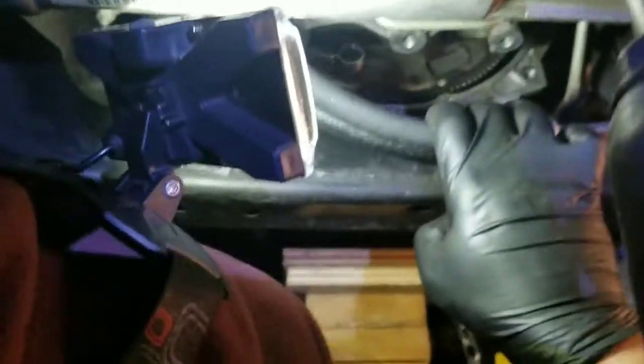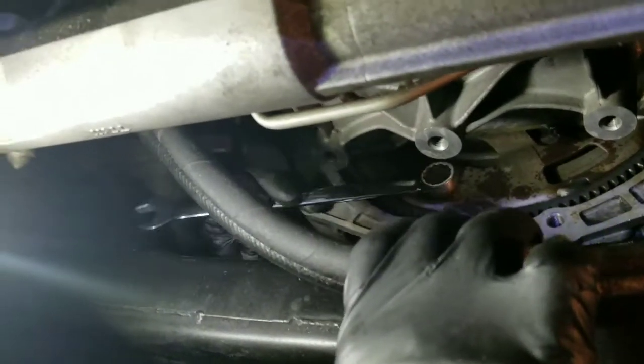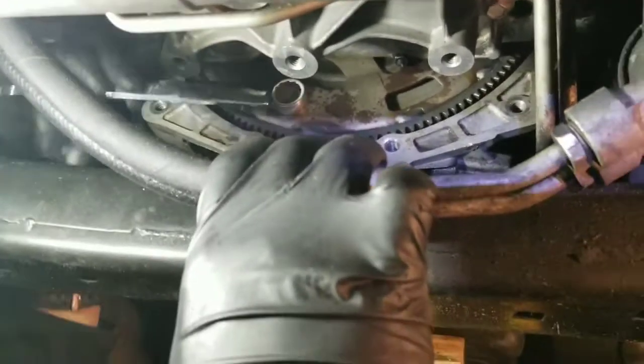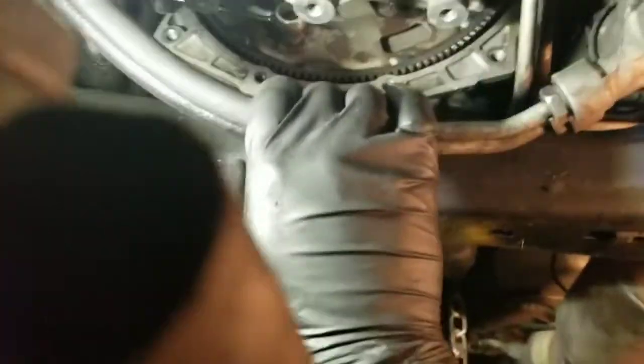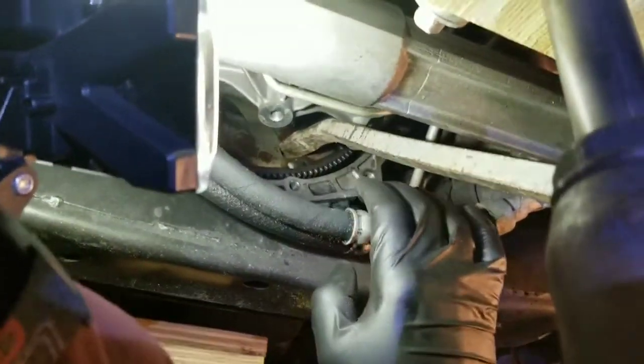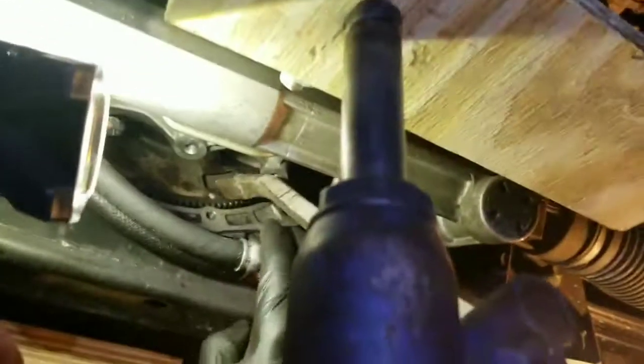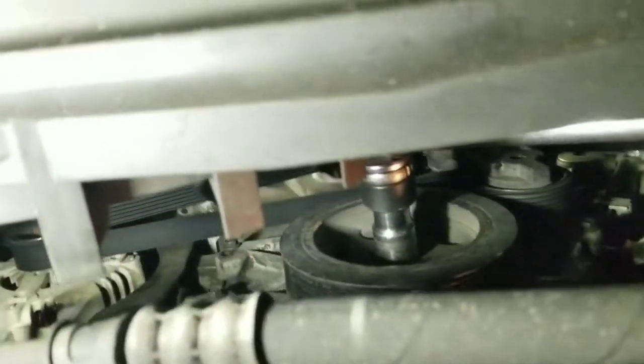Yep. Okay, so we were able to loosen the bolt with an 18mm wrench, yeah, regular wrench, and because this turns, you can use this kind of tool to put in here like this and hold it against the engine oil pan, yeah. And you can also turn this as well, like that, without turning from there. Broken loose completely. So the best way is to turn it like this, and it's gonna turn there.